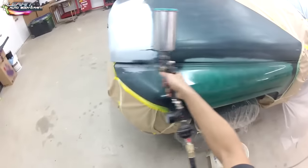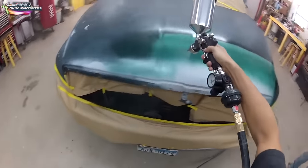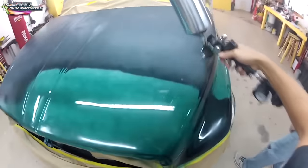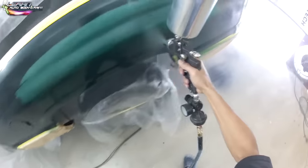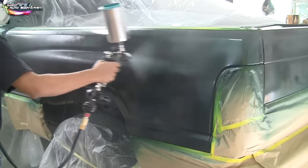When doing little touch-up repair jobs like this, you always want to cover your primer area first. I'm not painting the whole hood yet — I'm going to put two coats on the primer areas first, then go over the entire panel — the whole hood, the whole fender — with two coats as well. You want to cover the primer areas first because they're lighter. If you just covered the whole panel, it would still look a little gray. Make sure you get the primer areas to the same color first, then paint the whole panel.